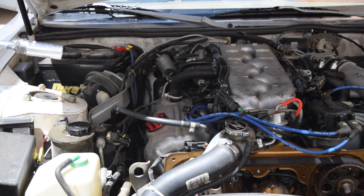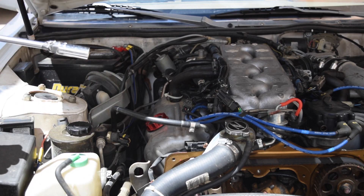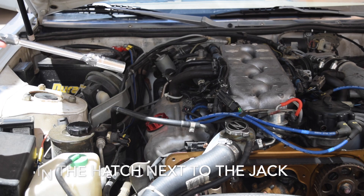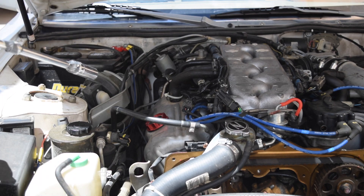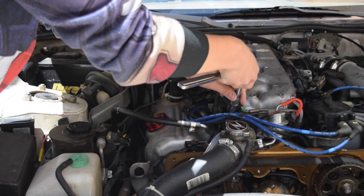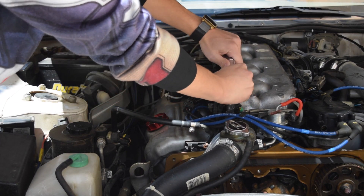Now that we've blown it out, we're going to use a 5/8 socket. There is supposedly a tool in the back tray if you have yours — mine didn't come with it — but it should be a long rod. I'm just using a couple of extensions, and I always put tape on mine because some come off and it gets really annoying. Go ahead and stick it down in here and undo it.